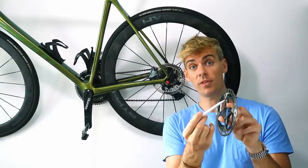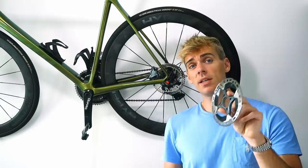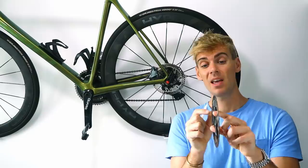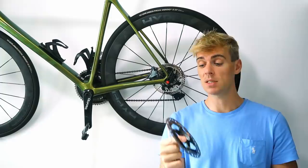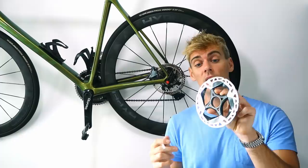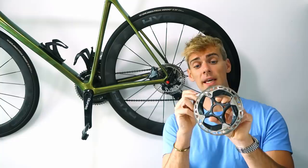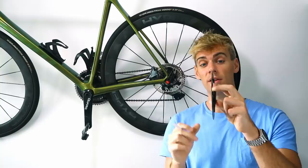A minimum amount of heat is designed to go into the spider through the pin joints, keeping the heat away from the hub and bearings. In this design the heat is lost through the fins before it gets to the spider. It's got a floating rotor design, pinned on four rivets - that goes for the Campi ones as well. But the thing I don't like about these is they just don't last, and they're very easily knocked out of true because the aluminium sandwich core - probably about two-thirds of the whole thickness - is not very stiff.